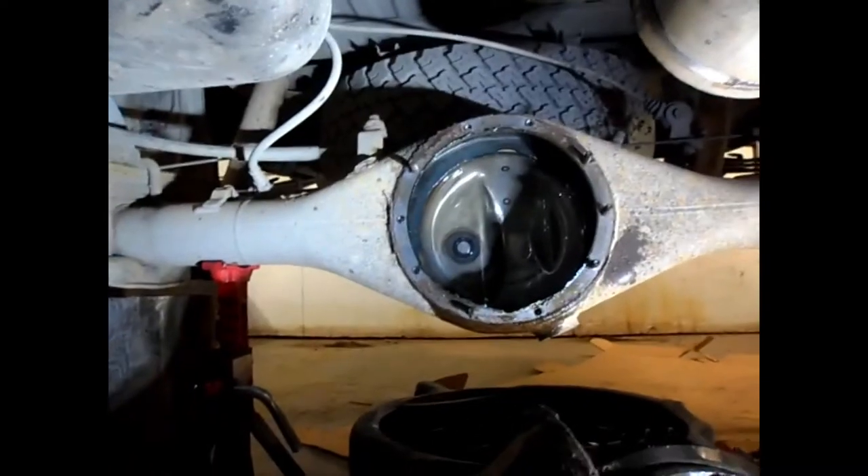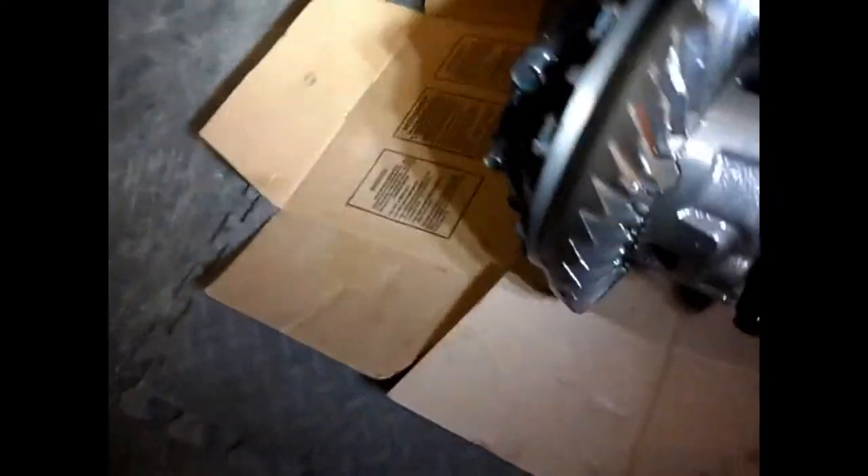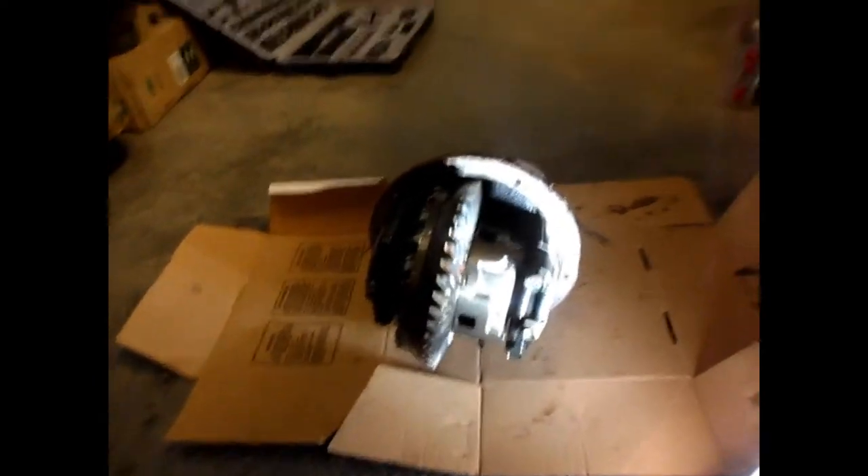There it is and there's the empty hole. This is the third member — I'll just pull it up and look at it. I haven't done anything yet, just a quick look, and the first thing I see right off the bat is a tooth — half a tooth missing. That's not good. If I turn it... yeah, that's the same one. I don't know when that happened, so I guess I have to buy a new ring gear now. It's a good thing I took it apart and found that.